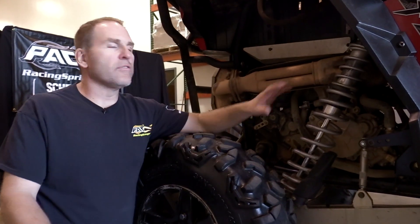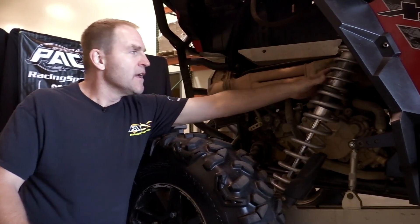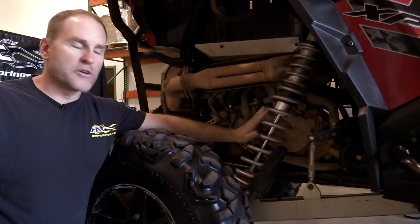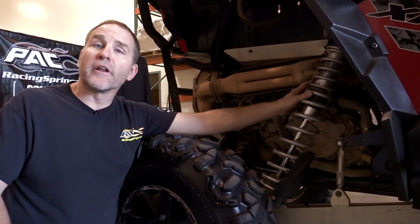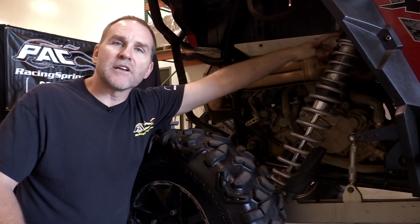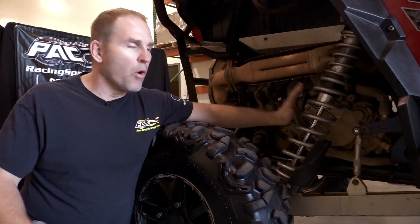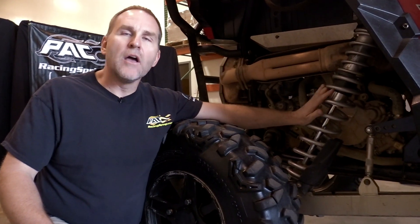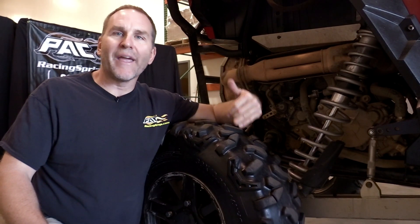We've lifted this thing up on the lift to show the full travel of the suspension — the tender spring is fully expanded, still keeping load on the main spring that supports the weight to keep the lower collar intact. A lot of people when they start putting a lot of weight in the ride will jack this top nut down to get their vehicle lifted back up again. All you're doing by doing that is putting more spring load into it, which is going to affect the ride even more. By going to our dual rate system adjusted with the lockout ring, you have a smoother ride all the time and a spring rate that's able to handle the additional weight you've added with all your extra goodies.